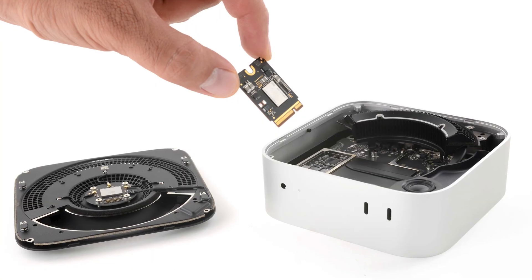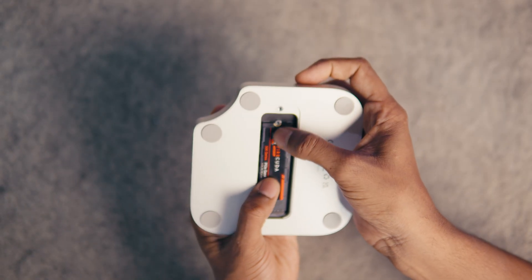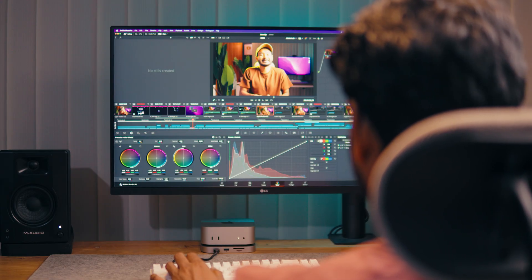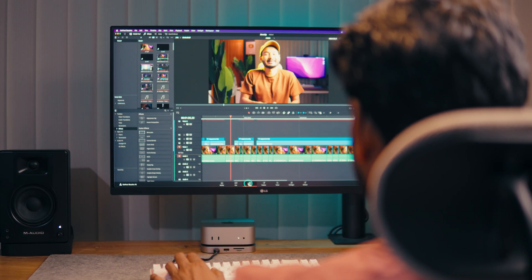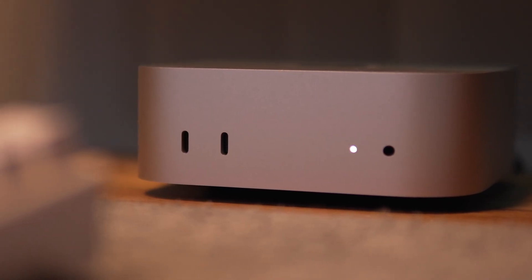Some people are swapping the internal SSD with third-party SSDs that are faster than Apple's internal SSD, but 90% of people won't bother opening the Mac mini for that. If you're a video editor working with large files, you'll need an external SSD — I use a 4 TB SSD and edit directly from it with no storage issues. I also use an SSD enclosure when needed. With DaVinci Resolve I notice smoother editing performance compared to Adobe Premiere Pro, and Resolve exports video even faster. For 10-bit H.265 footage, Premiere Pro takes longer to export on this Mac mini — it's an editing machine, not an export machine, and it's slower than even the M1 Max chip in export time due to fewer hardware encoders.